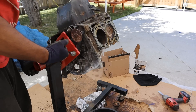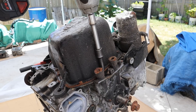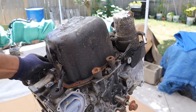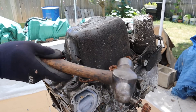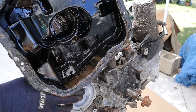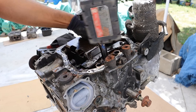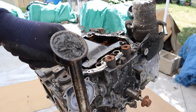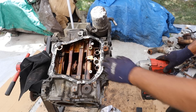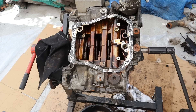Now I'm going to flip the engine over. With the engine now flipped upside down, I'm going to remove all the 10mm bolts that hold this oil pan on. I find it interesting that Subaru is still using lock nuts on these oil pan bolts — unless someone's been here before. It's messy — definitely a milkshake in there. Let's get the windage tray and this pickup tube off. Look at that pickup tube — it's clogged with debris. That probably starved the engine of oil. I can actually use the impact to break the engine free where it was seized, so the rotating assembly seems to free itself up now.